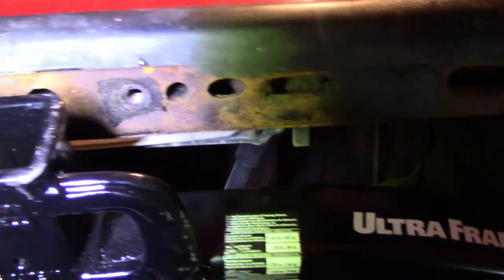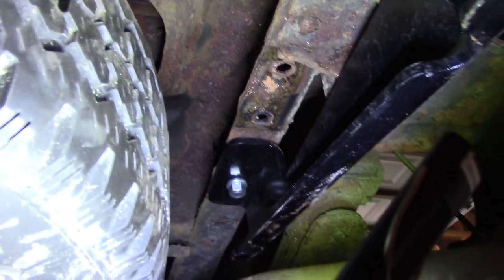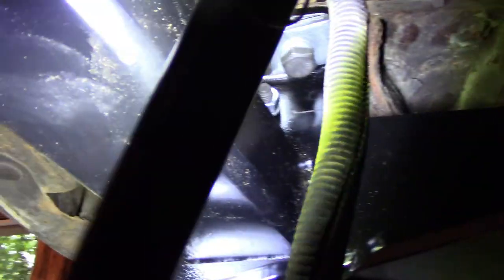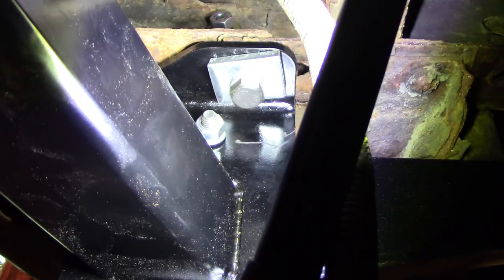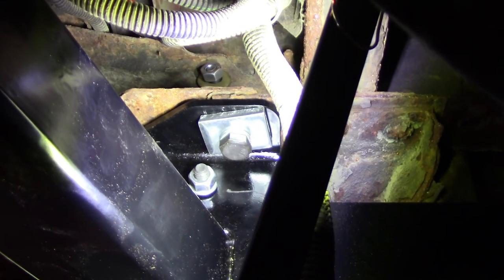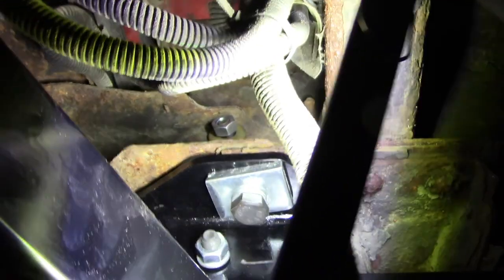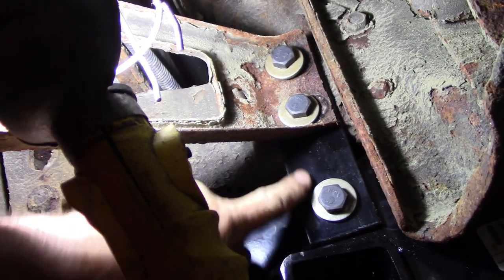I like that it's not connected to the bumper anymore — everything's on the frame. The forward bolts are fine thread, and up there I used the big thick inch-and-a-half block. We haven't tightened anything up yet. This bolt here is the coarse thread and that's a three-eighths block, and on the top there is the welded nut — just a lock washer and the bolt going straight up.